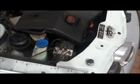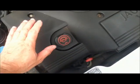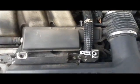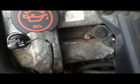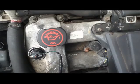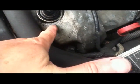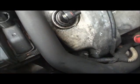Now this car does have a problem with oil leaking from the top and going down to the bottom. So I'm going to take the engine cover off so I can just inspect what's underneath. We can see the top of the engine more clearly. You can see that this is actually now really dusty. There's lots of sand in there. But there are no great signs of leakage. Now my theory is this leaks. You see this? I think this seal here, this leaks, it weeps and it goes down.